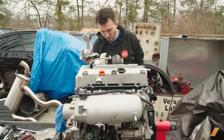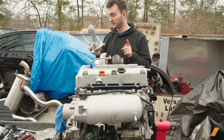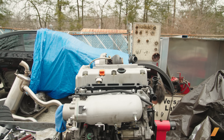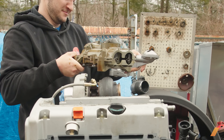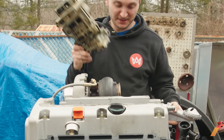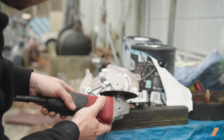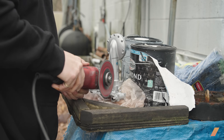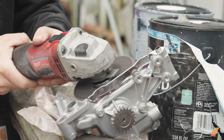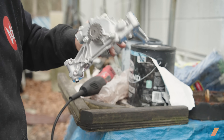The next morning began with me completely forgetting to turn on my mic and going straight to working. I took off the oil pan and stock oil pump. There are two reasons to do this: one is because you want to rev higher, and two, you want to replace it with the RSX Type S oil pump, which is substantially smaller and can handle much higher revs into the 8,000 RPM range. One thing you do have to do is modify the stock oil pump — and what does it feel like modifying a stock part that costs hundreds of dollars? Let's just say I cut a lot slower than I normally would.